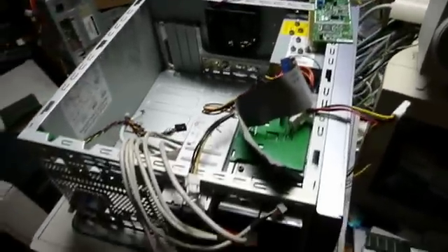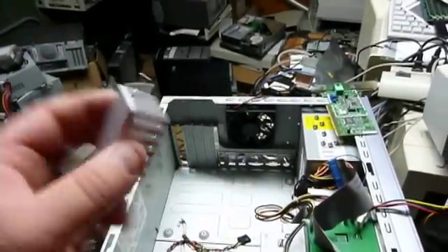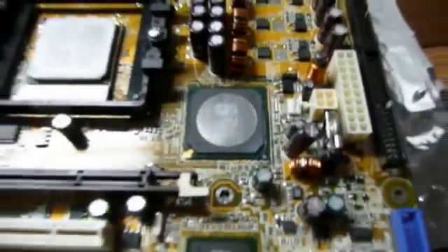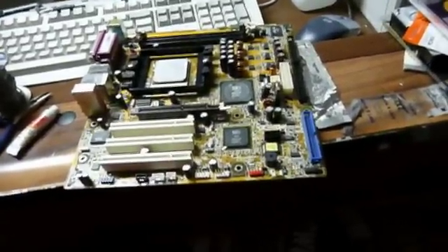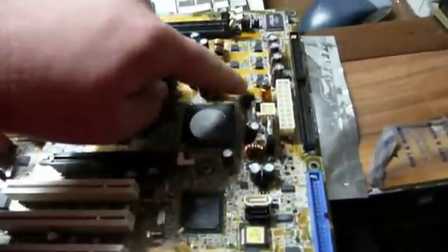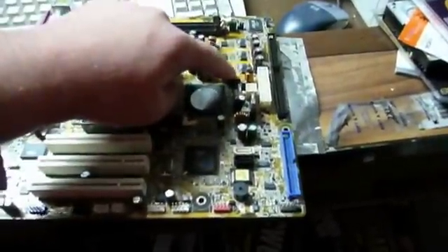So I was a little surprised when I took it off their computer desk and I heard something rattling in the case. It turned out it was this — the heatsink off of a north bridge. This is the motherboard out of said computer, and that is an SIS-760LV north bridge, which was running with absolutely no heatsink on it. There are little clips that hold the heatsink down over the north bridge, and this one up here had pulled out.